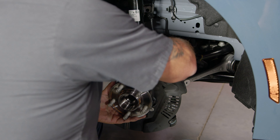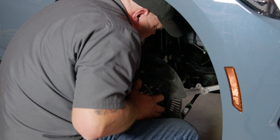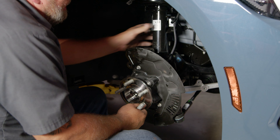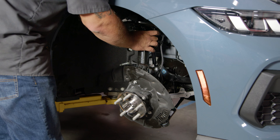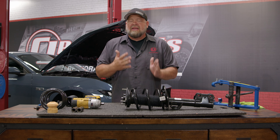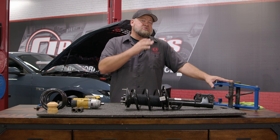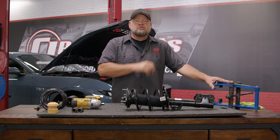Now you can actually work the bolts out, just kind of shimmy it a little bit. Grab the strut, remove the hand-tight bolt from the engine bay, and remove the strut assembly. Do the same thing on the passenger side. Once we have our strut assembly off the car and on the table, we have to compress the spring to remove it. You will need a spring compressor for this part of the installation. There are less expensive versions available — this one's around $300 or so — but a lot of auto parts stores will rent these, so just make sure you have one in advance.